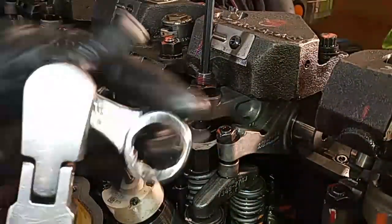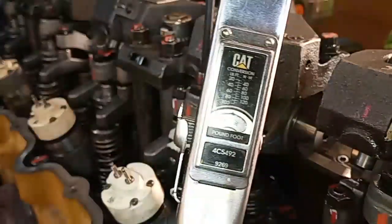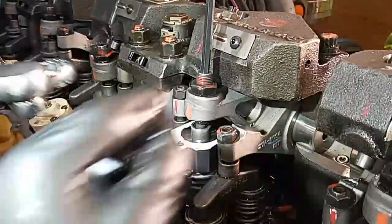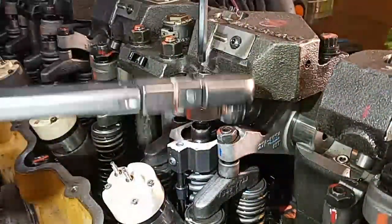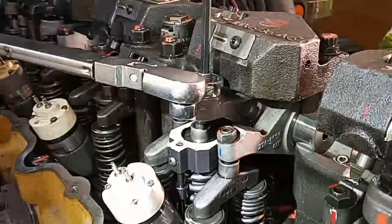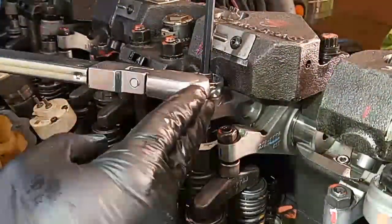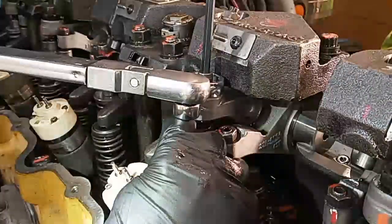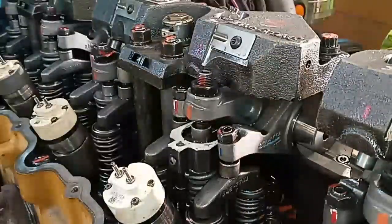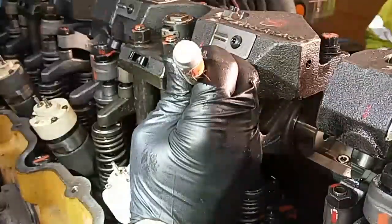Use the 3/8 torque wrench with higher output since we're doing 74 foot-pounds here, with a 7/8 torque adapter. Keep the ratcheting head on the same plane as the torque adapter. Once it clicks, you're done — as long as you didn't move the adjuster. Some locations you can't use a closed-body torque adapter and may need an open-end style. We've now covered the intake, exhaust valves, jake brake procedure, and injectors.